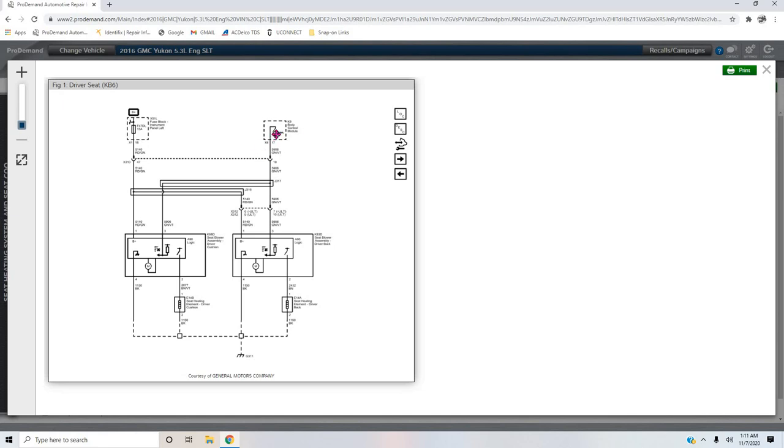The BCM, if you look, is also tied in on this power feed circuit, and it's also tied in here, internal. So what exactly is the BCM doing here? Because if you look, it's got a switch with a ground symbol inside the BCM. Well, it's switching and pulling that voltage low, but there's some kind of regulator in here that's interpreting inside this logic that pulled low signal from the BCM. The BCM is in control of both these blower motor assemblies, and it's doing it on one wire.